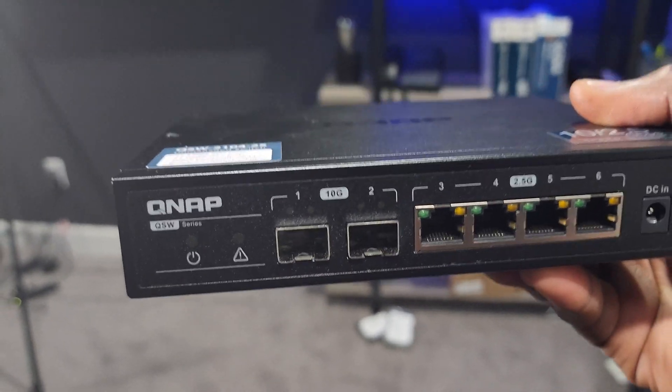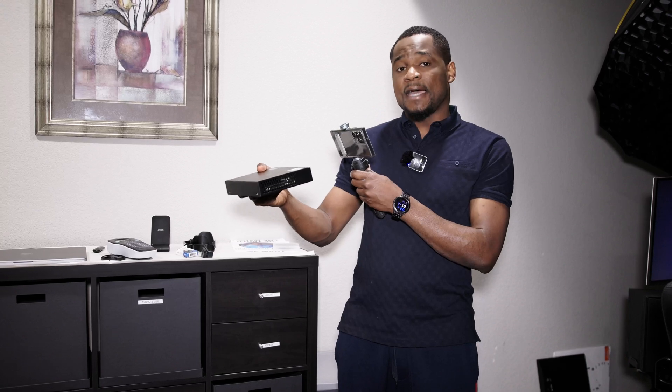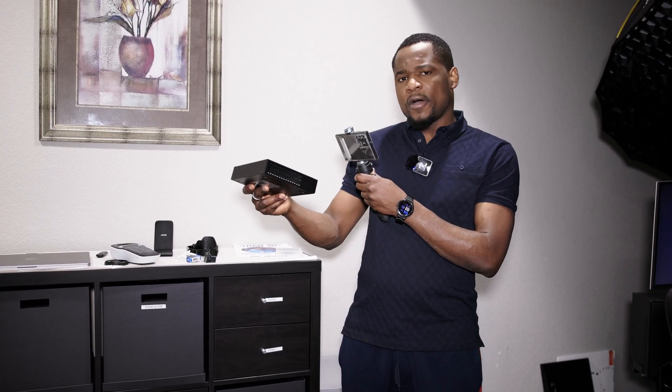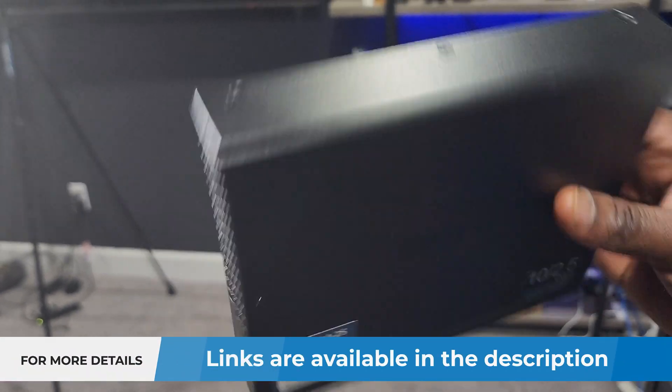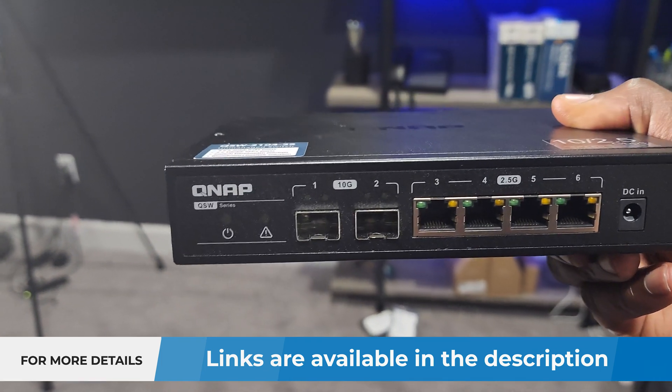It comes as it is — you just plug in your devices and they start talking to each other. No configuration, no VLANs or anything you have to do. Whatever VLAN you throw at it, it doesn't add any tag — it will just forward whatever packet it receives. That's not a problem. At least for my use here, I don't need it to be managed. This one will do the job. It's very small. I'll leave a link to it down in the description.